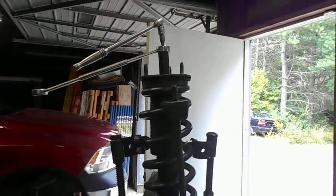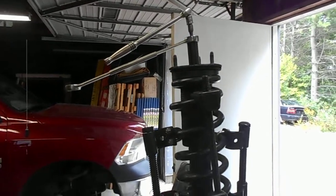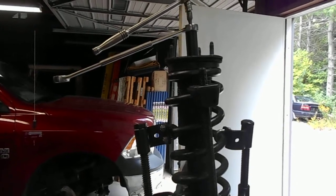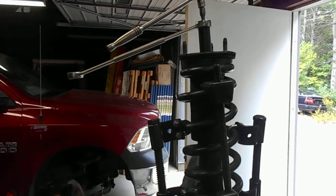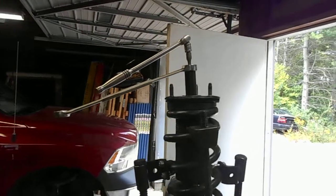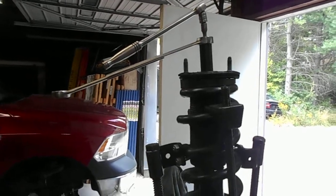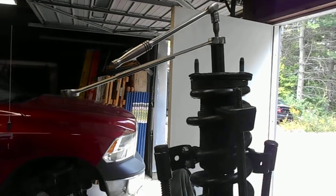If I was to make another one, I'd suggest you see if you could find one where whoever's manufactured it has made the hole large enough that your 8mm socket will go through, and instead of drilling it like I did, find a die grinder and a small stone and just grind it out, because really there wasn't that much meat in the narrow spot to drill out. The first drill went through good, it was one size under 1/2. The next drill ran into the tough meat of the socket, and it just stopped it.